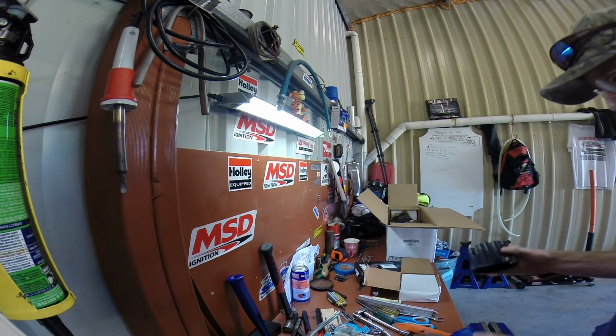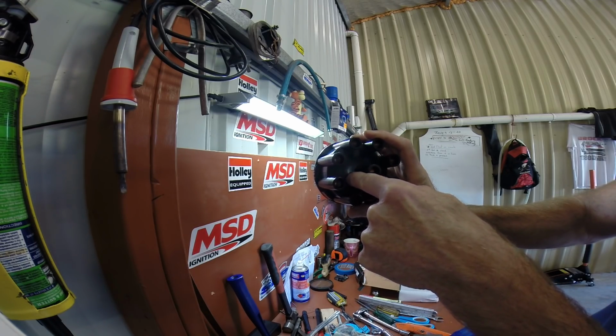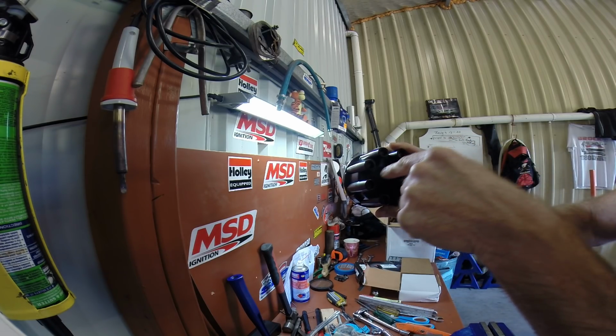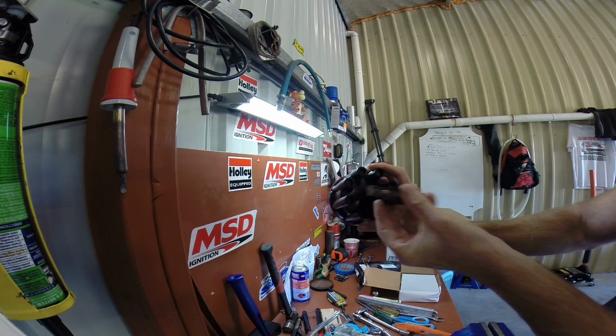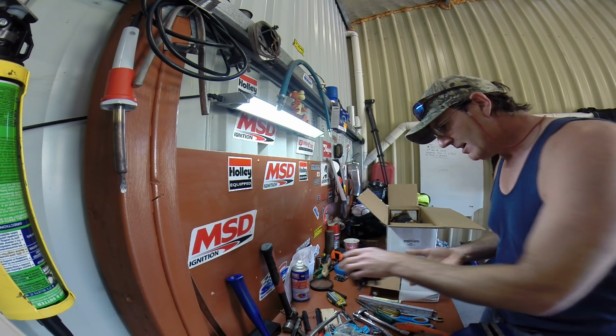So yeah, it wasn't hard to do. I ended up drilling a 3/8 hole on number 1. You just get the timing light on it and it flashes up, and you'll see where this is phasing. You'll just get a glimpse every time it comes around, and it's not that hard. So at least I know it's okay.